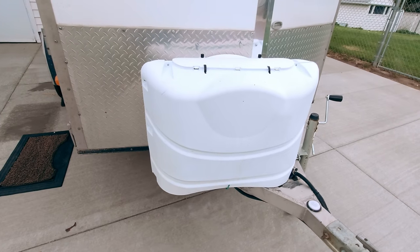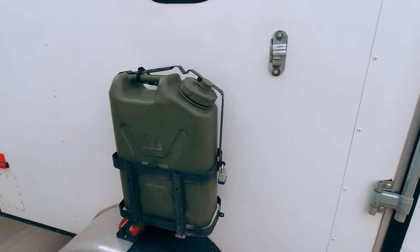This is a 6x10 cargo trailer, and most 6x10 cargo trailers don't come with brakes. When we first got this trailer and built a camper package into it, we didn't feel a need for brakes, and we towed it all over the western half of the U.S. But lately things have changed — we've added a second propane tank, 5-gallon water jugs on each side, a bike rack and a heavy e-bike, plus batteries and other items. Going down a steep mountain road, we're tending to overheat the brakes in the Yukon, and that tells me the trailer needs brakes.